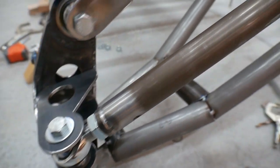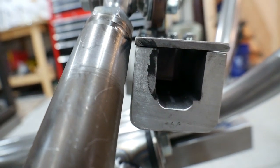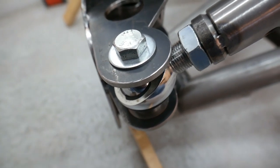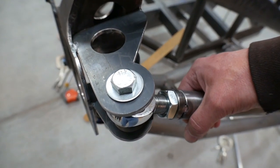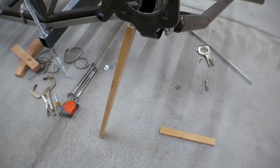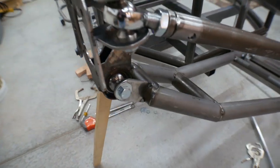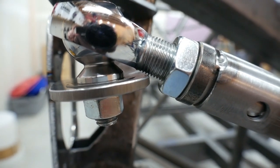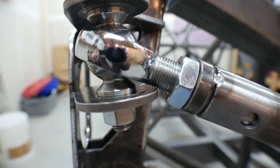My steering is always my limiting factor. Up at full compression, the steering link just clears the rack there, which is fine, so it can go down as far as it needs to. This is also my limiting factor on compression. If I bring it up until I feel contact, I can prop a board under here. I've lost a little tiny bit of full compression compared to before I had any steering on there. The limiting factor is the same here as it was on full droop — it's the steering arm. I could still feather that in a little bit with a grinder if I needed more travel, but for now I'm good with that.